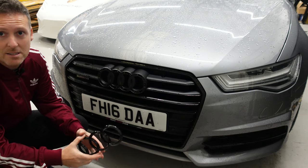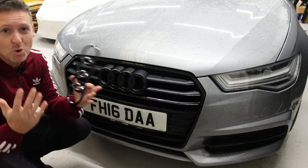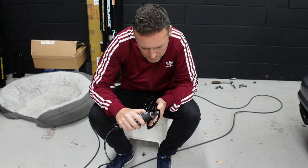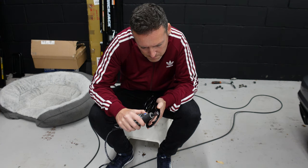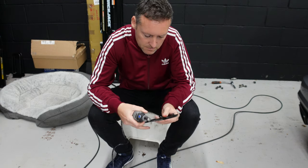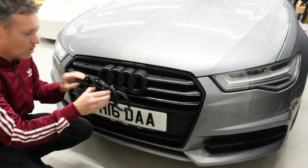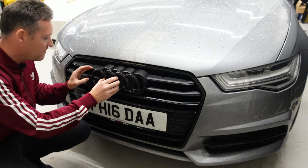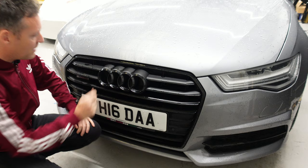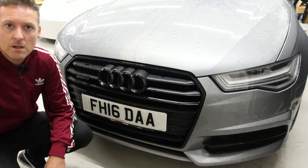It's actually the next day. I contacted the seller about this front grille badge. He didn't reply, but he did give me a refund straight away, so I guess that's him holding his hands up and saying the product isn't suitable. What I've done is modified two of the little clips which don't fit the apertures on the front grille of the bumper. I've basically removed two of the clips and I'm going to pop this in now to see if it will clip straight in and hold solid — I don't want it laying loose. If you're in this situation, you just need to remove the top two corner clips and then it will fit in no problem. I'm quite happy with that.